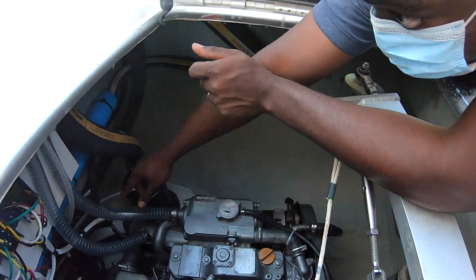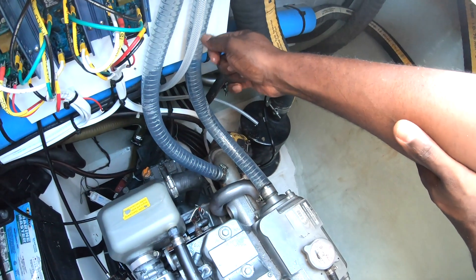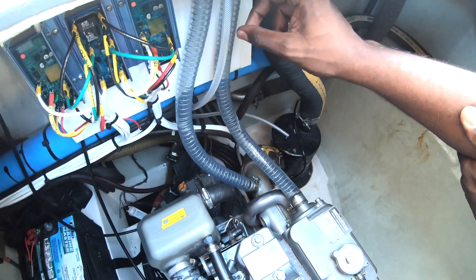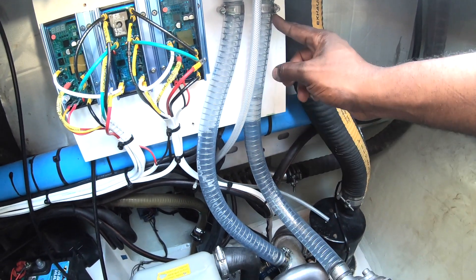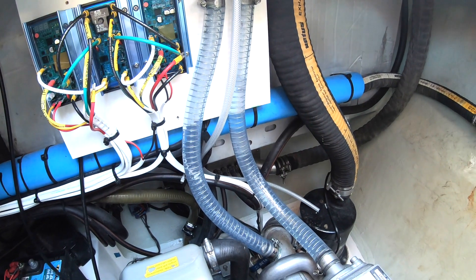Look, exactly what I was explaining. You see, this is water here — see, here it's still full. See where the water is? And look at the other side — it's empty. The vent: once you shut the engine down, the valve opens in the vent loop and allows that side to flow down. But there's no way that side can go up against gravity. That's the whole point.